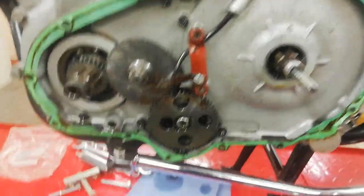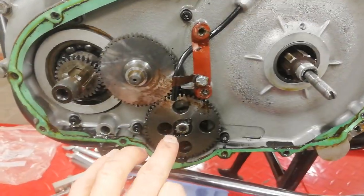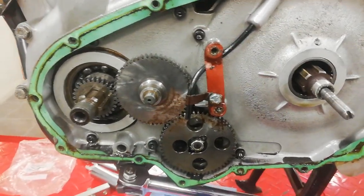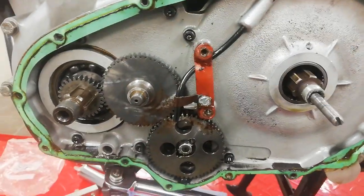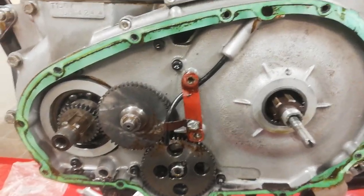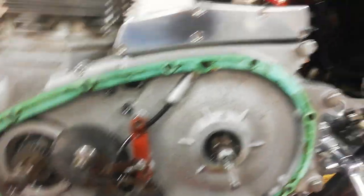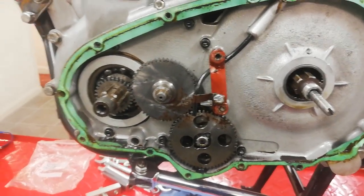What's left now: you've got the oil pump here with the idler drive for the oil pump. There's also an extra oiler feed for the primary chain — this was on the T150 but they discontinued it for the T160. There's a little oil catch there and it's supposed to run down and add oil to the primary chain. We're going to leave it there for today to keep things nice and short, then take these off next and remove the inner chain case cover, which will give us access to the clutch behind there.